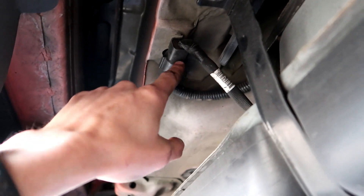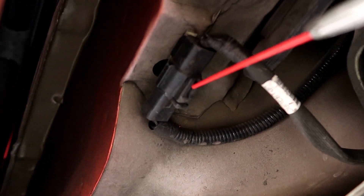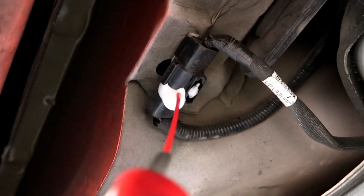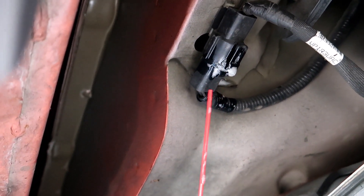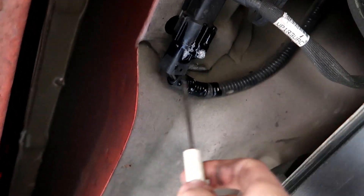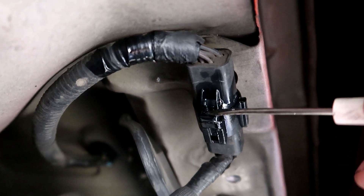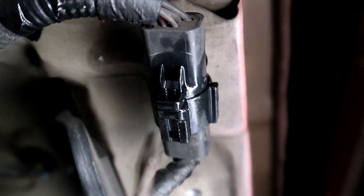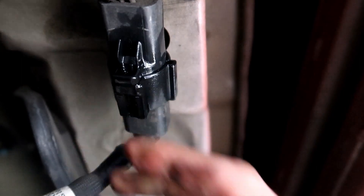I'll show you a tip for doing these style connectors. Two things you need are a small flathead screwdriver and WD-40. I like the cans with the straw because you can get them real close and spray into the connector. Spray that, and I'll usually put a little on the whole connector itself and get some up above so it drips all the way down and around. A lot of times it's better to come from this direction and spray it into the connector - you can see when I did that it came all the way over here. Then get your screwdriver - the tab is on this side right here that you depress, and then you pull. Sometimes it doesn't work because the plastic just flexes, so get your screwdriver in there not to pry apart but to depress that tab - once you've done that it should just pull off.